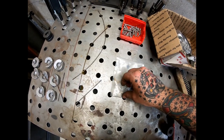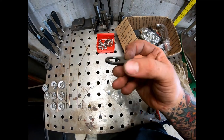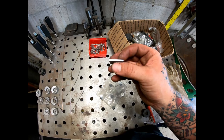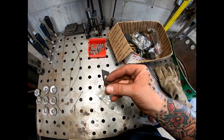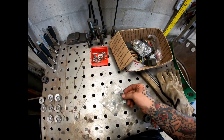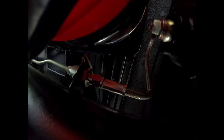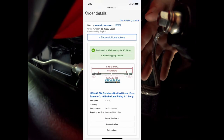I can kind of see the little tab I added right here. When I ordered the disc brake brackets, they had these little laser-cut tabs on sale — I think I paid a dollar a piece for them. All I did underneath there was cut a little eighth-inch piece, TIG'd it to this, drilled a hole on the frame, and tapped it so that can mount to it — that way I didn't have to do any welding. For a buck, it's worth it. I bought quite a few of them and I'm just going to stock them on a shelf. Those are from Rough Stuff Specialties — they got a lot of good stuff if you want to check them out. I welded one of those tabs to the axle — that's where my hard line goes to. Then there's an adapter and just a smaller little flex line to this banjo. I purchased these from the same people as well. It's like that on both sides for disc brakes.